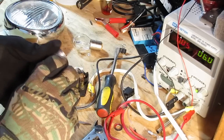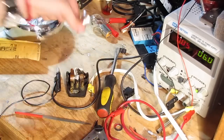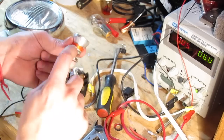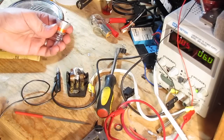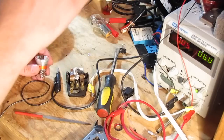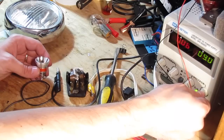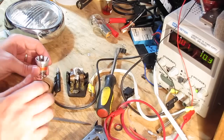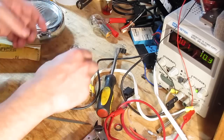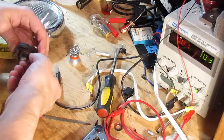Alright, so luckily, in my garage, I had another bulb that is very similarly shaped. This one's labeled as a xenon, which I think is a brand name, or actually a type of gas. And it's labeled as 14 volts, so maybe that'll keep me from getting into trouble like that. Actually, now that I think about it, I was hoping that the other one was going to be really robust and could handle lots of different voltages, because the scooter is definitely going to be kicking out some weird, dirty AC voltages. If it popped at 12, it was probably going to pop in the bike. That might have saved me from doing all that work, and then it pops first time out. So I'm going to take a stab at getting this guy fabbed up in here. And yeah, we'll give it a go.